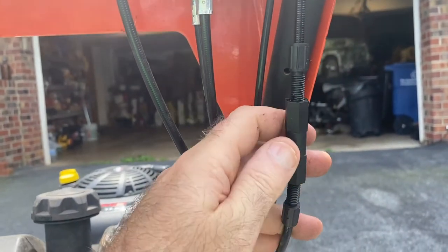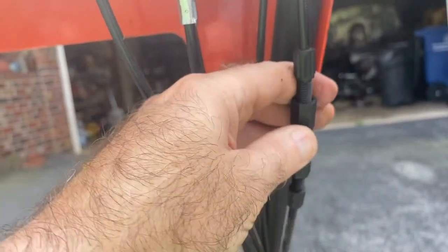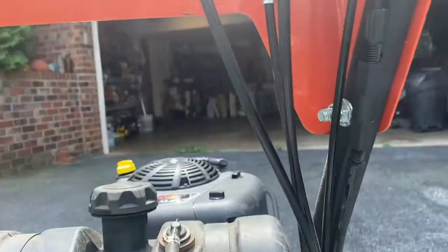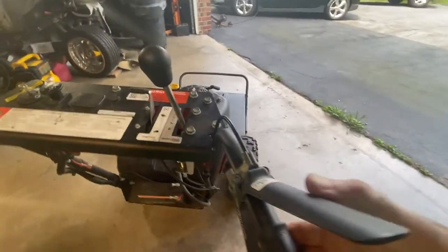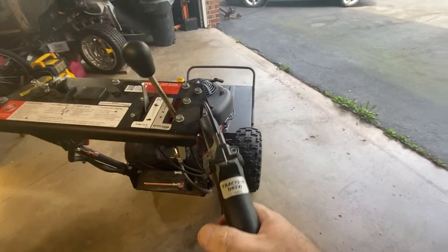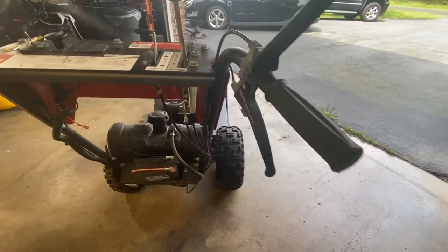This shows the belt change I made a couple years ago, selecting an AK-33 belt which is one inch longer than the original drive belt, because I couldn't get enough slack in that right-hand trigger control to keep the machine from ghost walking. Here I'm adjusting the cable stretcher to be as slack as I can to make the longer belt intentionally jump off the drive pulley, so I can show how easy it is to put the drive belt back on in the field.